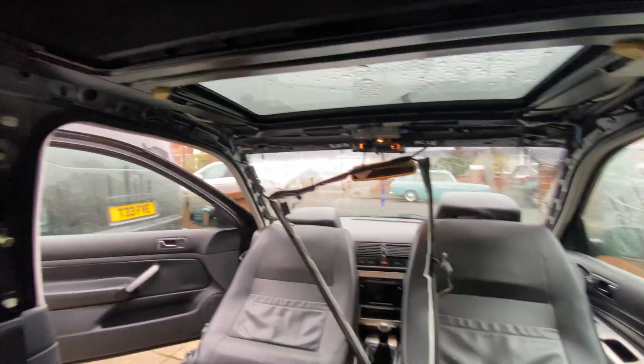There's also another one right over the other side, but that's the water channel. There was quite a bit of grease and debris and dirt in there, making it all gritty and grimy. So I'm now going to spray it up with the WD-40 silicone specialist, lube it up, move it backwards and forwards a few times. I'm going to repeat the process because at the moment you can hear the grit as it's going back. Hopefully cleaning it a few more times, moving it backwards and forwards and keep lubing it in between and eventually it should be free.